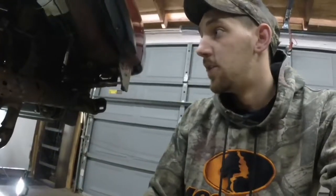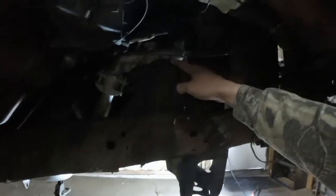So I started cutting stuff off the frame. From last time I was just pulling the old front end out — all the control arm tabs and everything on the frame I have to cut completely off, they're useless to me now. I'm going to leave the shock towers for now because I don't know if I'll be able to reuse them. I'd rather not cut them out and regret it later.